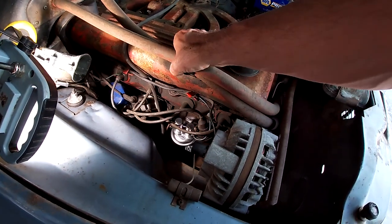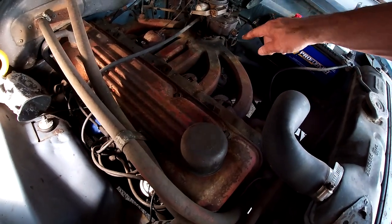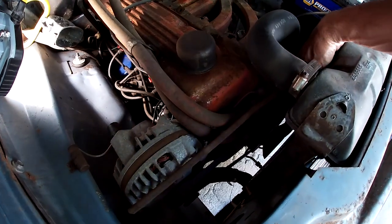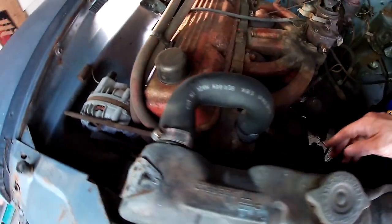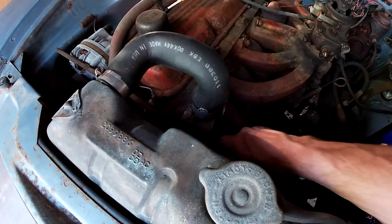And then you run the fuel line over the valve cover to the other 90, and that'll keep it, because the stock fuel line comes in front of the motor, in front of the water pump. There's even a clip on the water pump, so you get that heat transfer into the fuel line.